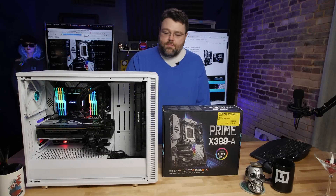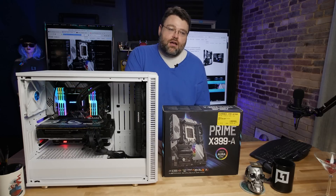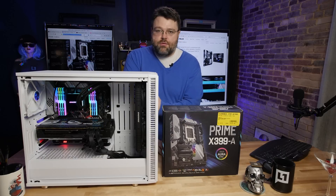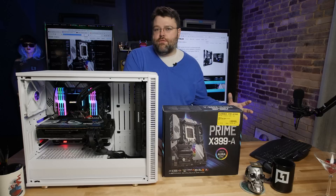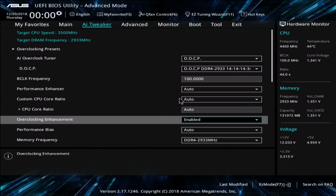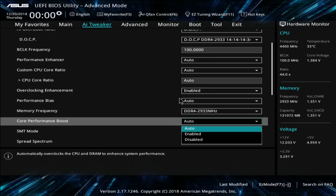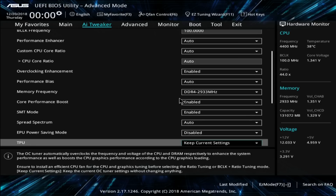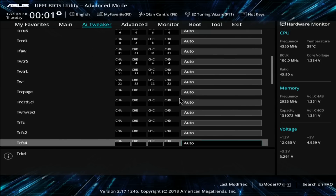With a fan layout that has fans in the bottom, a 280-millimeter radiator in the front, plus a fan at the back cranked up, that's sufficient airflow in my testing for a 2950X even with pretty significant overclocking. The top clock speed is going to be 4.3 gigahertz, and it's easy to have 300 watts of power being dissipated through the motherboard for the CPU with an extreme overclock — running 4.2 to 4.3 on a lot or all of those 16 Threadripper cores. ASUS also has predefined overclocks in the UEFI that mess with the base clock and dial in some presets, which are actually pretty nice and more robust than what a lot of other boards offer. That said, if you're willing to spend a little time dialing in overclocks on another board, you'll be all right.